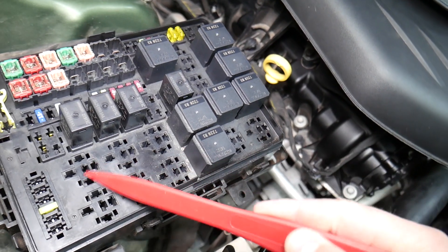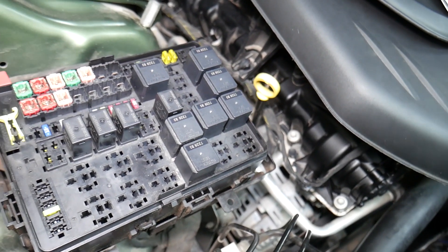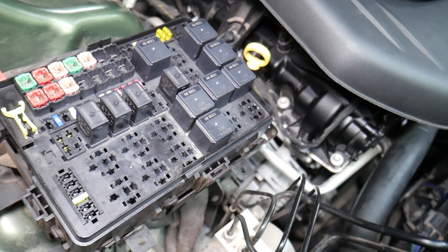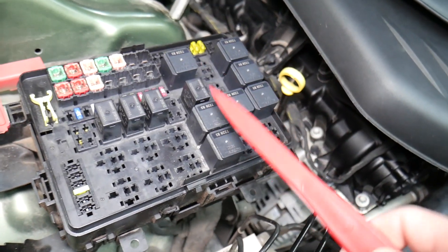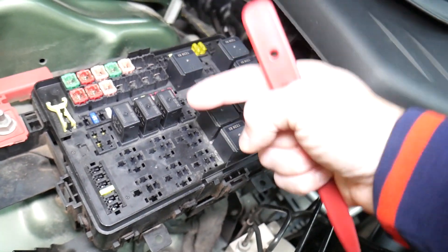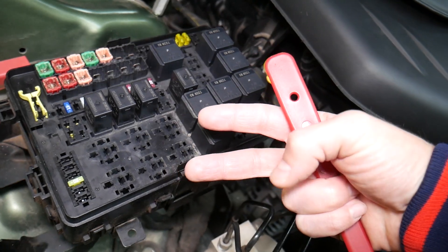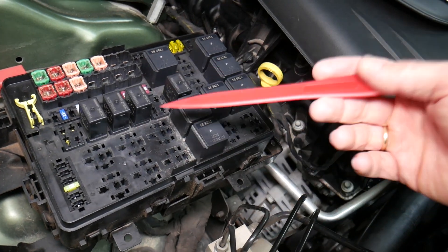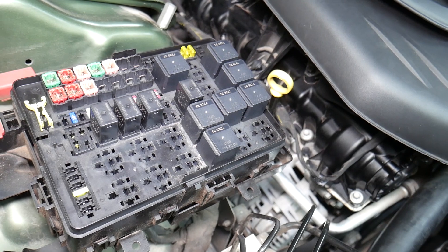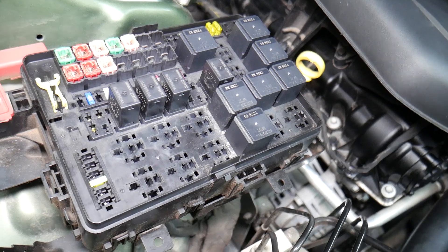For some certain fuses, it's important to disconnect the car battery when removing them, otherwise you can burn the electronics. For instance, when working on airbag fuses or anything like that, you need to wait at least one hour after disconnecting the car battery. And if you're not qualified and certified to work on an airbag system, I will never recommend doing that. When disconnecting the car battery, it's important to know which battery terminal you disconnect and reconnect first — if you do it the wrong way, you can burn electronics modules. We know because we burned a traction control module on a BMW that cost $2,000. We'll put a link in the description below on which battery terminal to disconnect first.